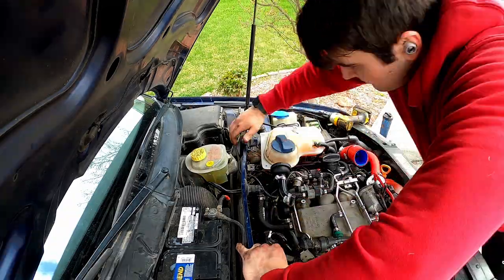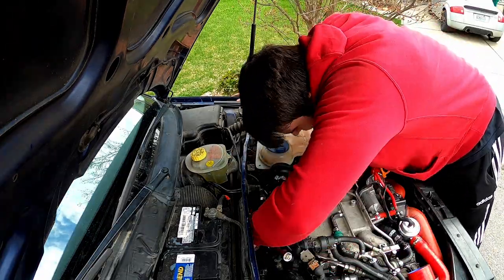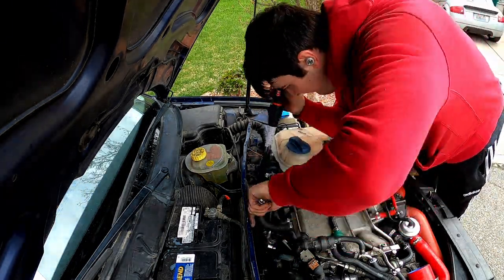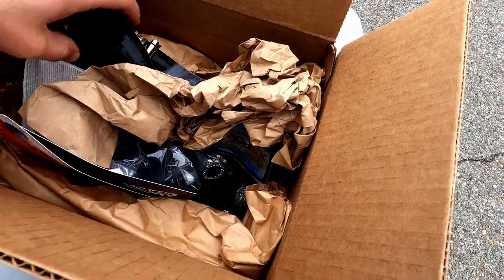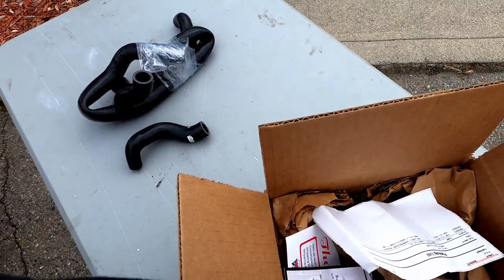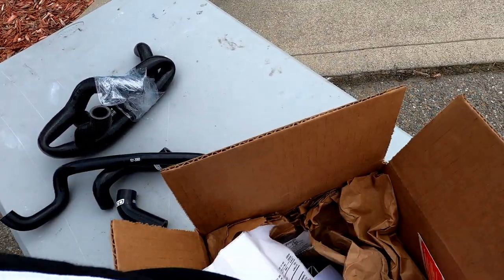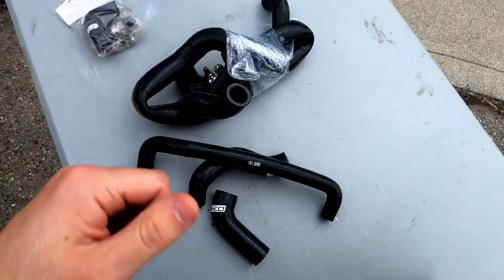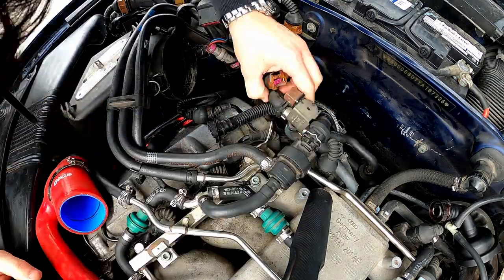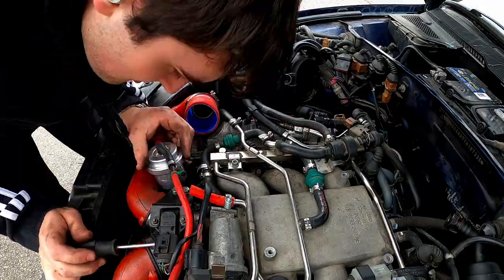You may notice that some of my PCV boost piping looks a little different on this car now. I upgraded my PCV system because of a major vacuum leak. I ordered a 034 Motorsports PCV upgrade kit. On this version of the 2.7T, the spider hose is known for going out because it's made of plastic, and it goes underneath the intake manifold — plastic that is rapidly heated and cooled. It is horrendously brittle and mine has lots of vacuum leaks; I can see a few of the cracks through the intake manifold itself. The 034 kit replaces all of that and updates some of it. It sits behind the intake manifold and looks like a spider — connected all over the engine.